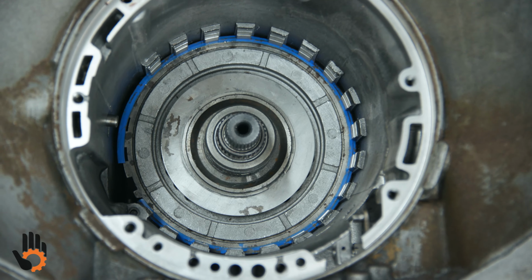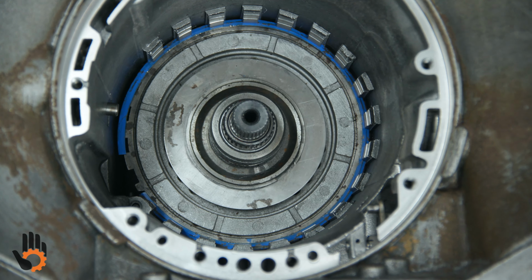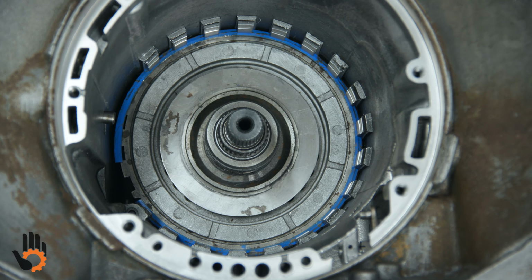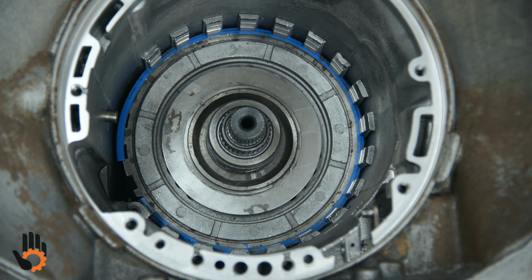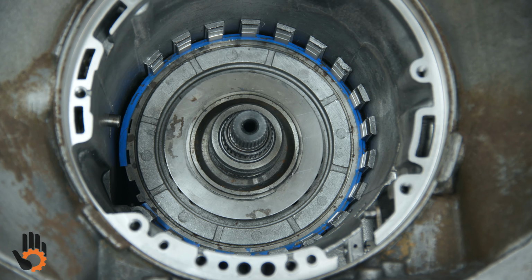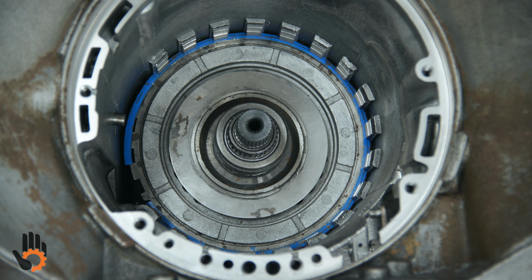So at this point, what we would need to do is go do our rear end plate check, if we haven't done so already and mocked it up, knowing that we may have to change that washer in the back of the case, so we don't want to go ahead and finish torquing our center support bolt at this time.